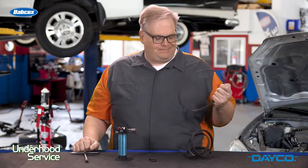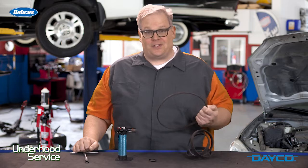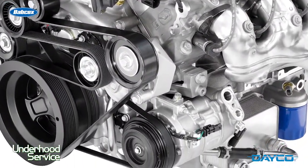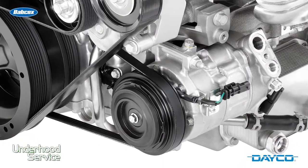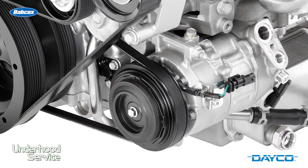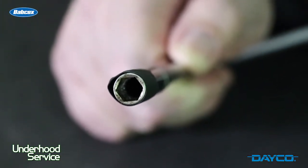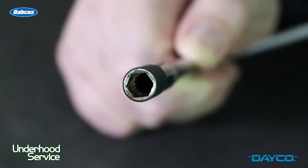So a stretch belt doesn't have a tensioner. So how does it keep tension over 100,000 miles? Well, it's actually chemistry. We're talking about thermosets. In other words, this belt is sort of like heat shrink tubing. Once it is first heated, it conforms. And when it conforms, it actually creates the proper amount of tension for the belt.